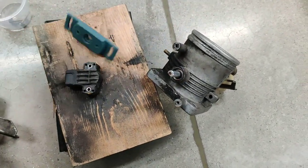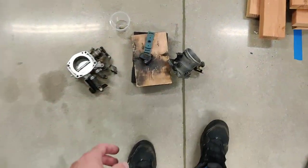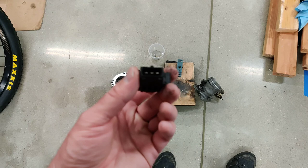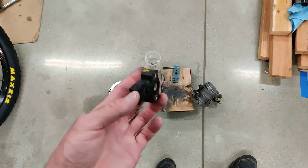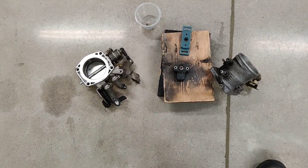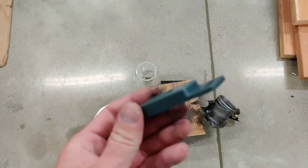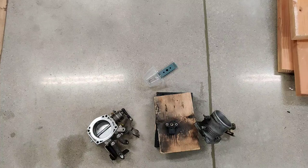This concept isn't just for BMW — it's anything. There are tons of different adaptations where you can use Honda throttle position sensors on Toyotas, Toyotas on BMWs, and BMWs on Hondas. Just make sure you have it wired correctly and adapted to your throttle plate and you're going to be fine. I'll go over the wiring in more detail in a video on the Megasquirt Tuner Studio software. Something as simple as a $5 3D printed part you can find for free on Thingiverse can get you going in a heartbeat.